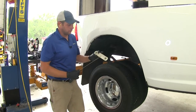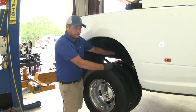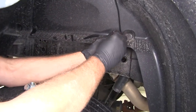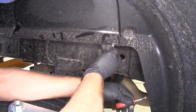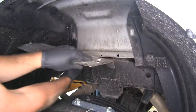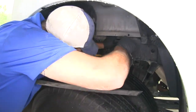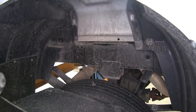With our hole drilled out, we can get our nut plates put in. These are going to go in through the wheel well where there's an access panel. There are two fasteners — kind of like pushpin fasteners — where you use a Phillips screwdriver to unthread the center, then pull it out and lift up. That gives us access to slide the nut plate in right above our gooseneck prep. We'll slide these in over the top, and once we get underneath, before we lift the head into place, we'll get them positioned. Then we'll go to the driver's side and repeat that same process.